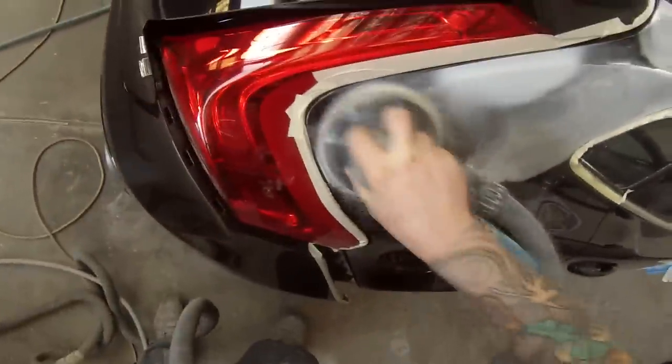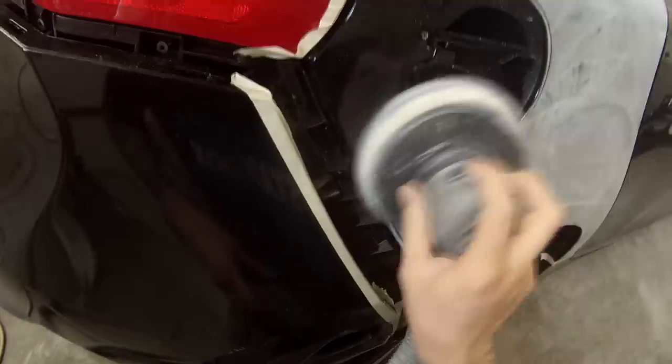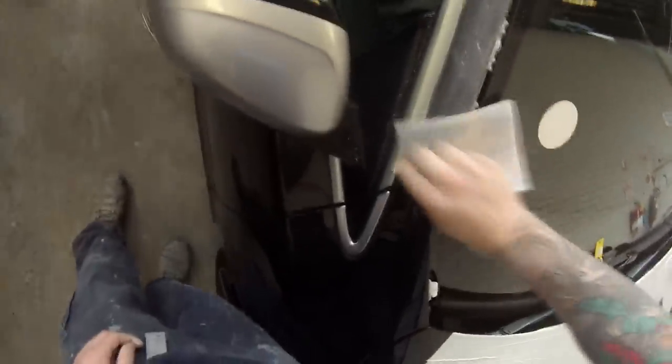So I'm using 600 grit here — this is the way I do it, it works for me. The other painter said whenever the prep work guy preps panels the way I like them, he ends up getting sanding scratches. Partly it's to do with how thick you have your paint — if you thin it down too much you might see some sanding scratches if you do my method. So you might want to take it down to the next finer grade, like 800 or 1000.